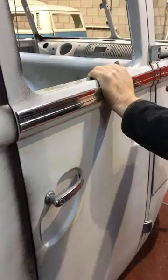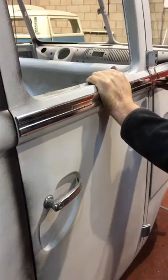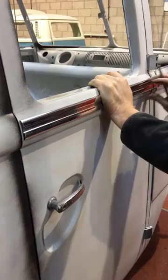We recommend you do not drill all the remaining holes until all of the trim has been installed. At that point, you can also countersink the trim if you wish. This will remove the chance of small lumps showing over the screw heads in the plastic infill. This happens particularly on very hot days.